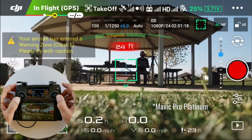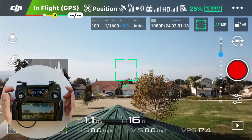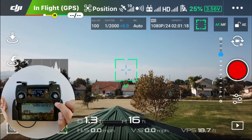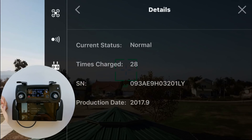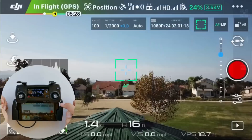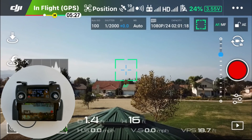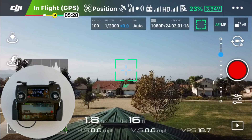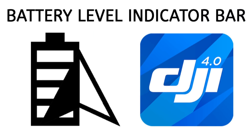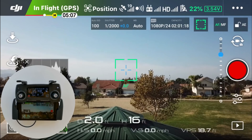The first test is with the Mavic Pro, starting at 25% battery with voltage at 3.71 volts, then I'll test the Mavic Air and the Mavic 2 Pro. For each drone I'll show you the battery screen and the number of charges. The battery warning settings are set at 10% and 15%, and these are only audio warnings that do not cause any action by the drone. The real focus is how the drone initiates landing actions as the battery discharges to and below zero percent, the control you have during these actions, and how long you have between key events. After testing all three drones I'll provide a detailed summary.